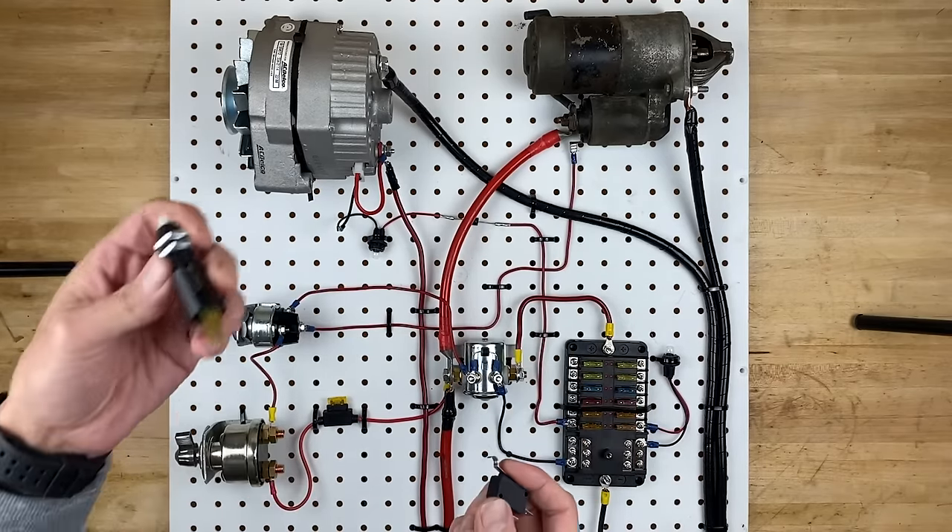Some starters don't have the solenoid on top of them — they have a totally separate solenoid mounted in a convenient spot under the hood, which makes for a great distribution block and it's really convenient to jump start your starter if you have a race car. You can actually convert one of these style starters to work off of a solenoid like this with a simple jumper wire. You end up with two solenoids on your starter which is kind of redundant, but it allows you to have the solenoid under your hood in a convenient spot. Now, I want my solenoids to match, so I'm actually going to wire up the matching one in place of the Ford solenoid.